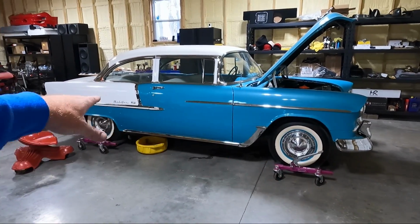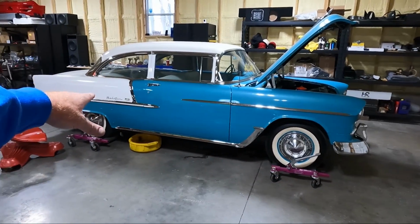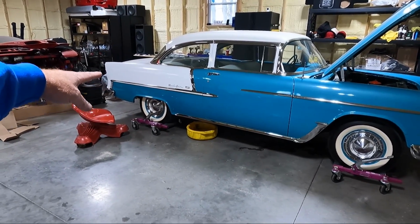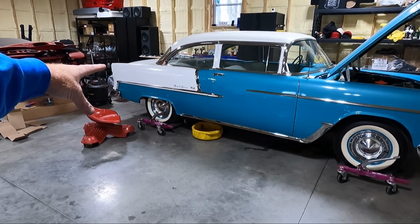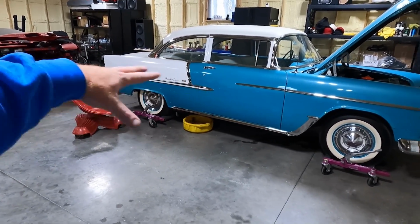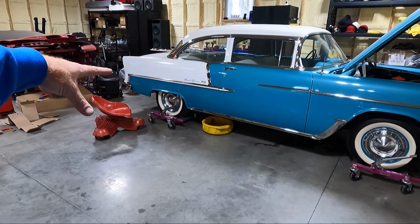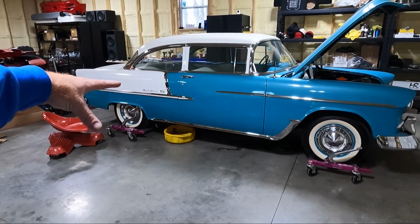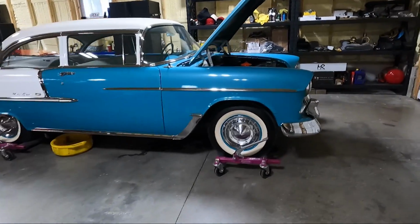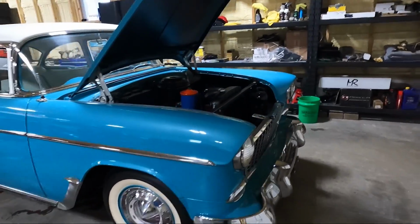The other thing is the driveline angle. You know, we want to get it set with the LS, and then we were going to weld our stuff on the rear end for the rear suspension because we have to set our pinion angle. So I really want to just do all this at one time. I don't want to be cutting stuff off later because the pinion angle is wrong, or trying to set the pinion angle here based on the rear end. I'd just rather get it all at once. So I know it's going to take longer to do it that way.